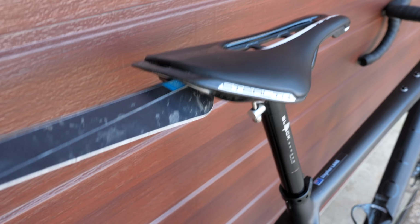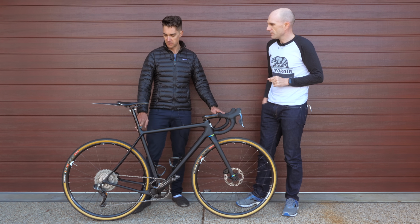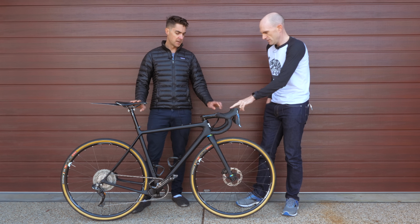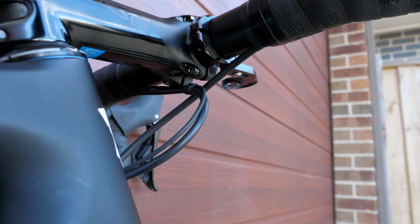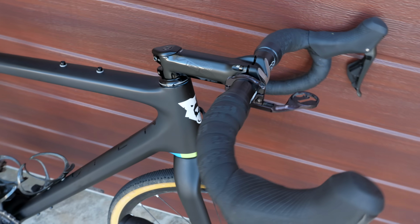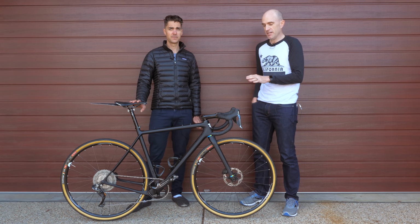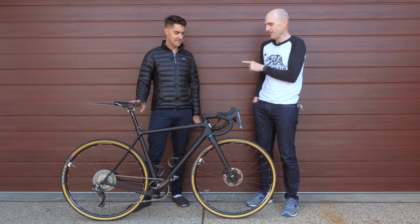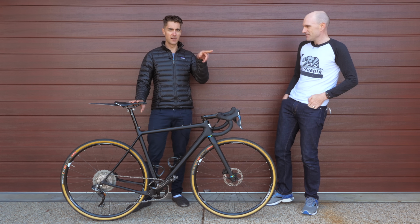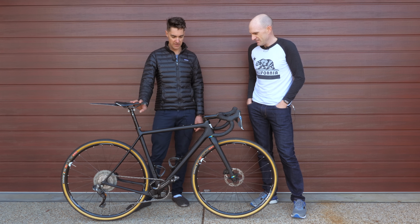Now, polishing off, you've gone the Shimano. So it's the Shimano Pro saddle. Saddle I always run. I had this laying around off one of my older bikes. It's a relatively light aluminium Tune stem, seat post, Pro stem and bars, which I always run. Drilled out a little bit to keep the cables nice and clean for the Di2. The way you do your bikes with cabling is brilliant. Whenever I go Di2, we're going to Slane's place and we'll do a build, because the way you hide everything away, it looks brilliant. Yeah, it's a bit of drawing out some diagrams, going, okay, I need a 550 mil cable for that one, and here and there, and figuring it out.